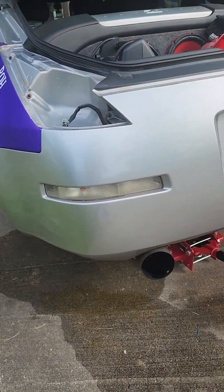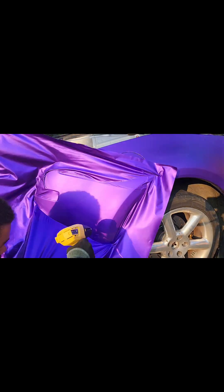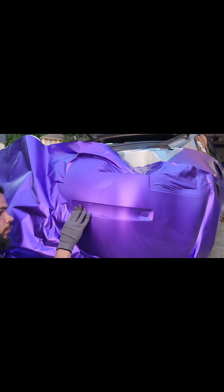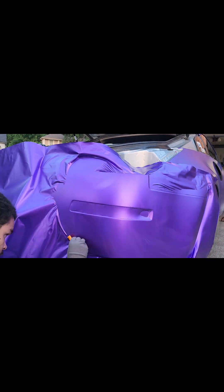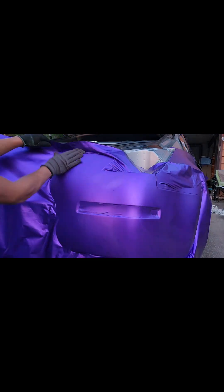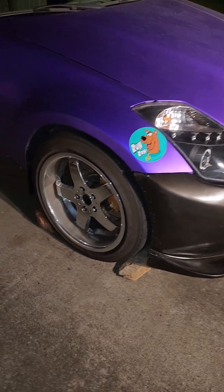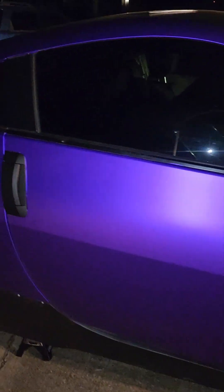What you're seeing here is how not to start. I started from one end and kind of worked my way towards the middle, hoping I could just lay it from one side to the next, and it worked out fine until we got over some weird curvatures of the bumper. Next time I try this, I'm definitely going to do it inside so I have control of the temperature around the wrap. I also learned I probably should have laid the wrap across the full span of the bumper rather than starting from one end and working the rest of the film off the backing.